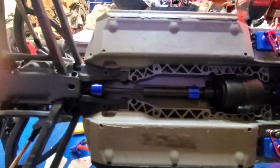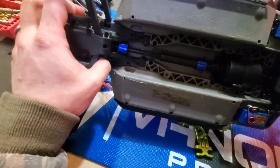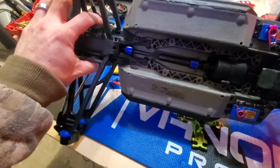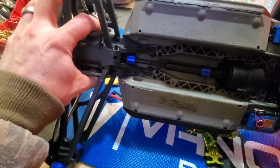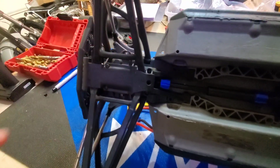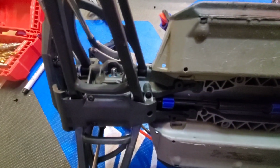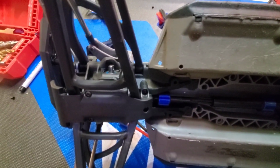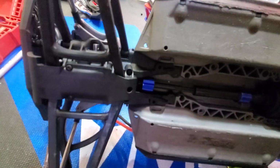So, anyway, the rear differential has been such a mission. I didn't even really intend to do much to it. I was going to put the leading edge machine gears in it and the aluminum diff cups, and so I go to put that in there, and I found the internal gears, the spider gears, all that stuff looked great, but my ring and pinion were pretty shot, and my bulkhead was shot.